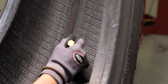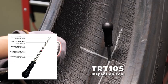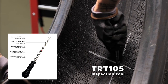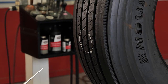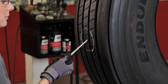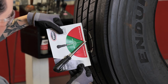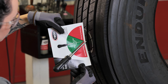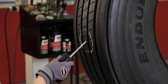As we evaluate the injury to the tire, if the object is still present you need to remove it. Using Tech's TRT-105 inspection tool, you'll be able to quickly and precisely measure the size and angle of the injury while minimizing the chance of enlarging the damaged area. If the injury exceeds 35 degrees, a two-piece repair must be used, as extreme angles can put excessive stress on the repair at the base of the stem.